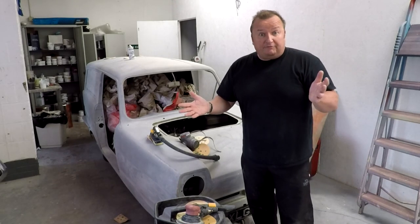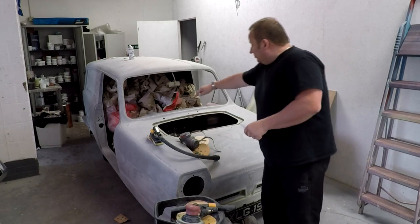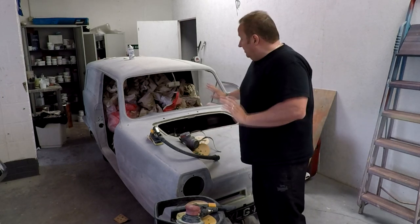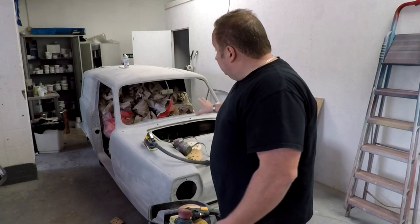I've not been down here for about three or four weeks now, and I've still got the odd little bit just to rub down around the front lights, just on the insert of the bonnet there. But what I'm going to concentrate on today is the electrics. I want to get the electrics out. I don't know what condition the loom is in, and all the connectors, so I thought the best way to deal with that would be to strip it all out and lay it on a bench somewhere where people can actually look at it, and if I need to renew any wires where they've got brittle or any connectors, I can do all that in the luxury of the open space instead of in the bonnet area where most of the stuff is.